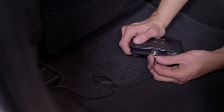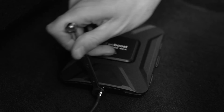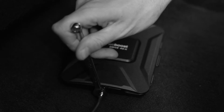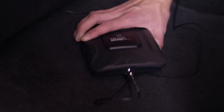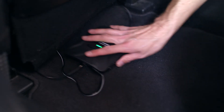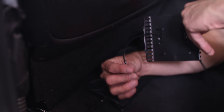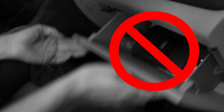Now install the booster. Connect the antenna cables to the proper connections on the booster. The cable connections should only be hand tightened — do not use tools, as using tools may over-tighten the connections and break them. With the cables connected, mount the booster in place. You can simply slide it under a seat or mount it securely in place. I'll use some zip ties to mount the booster under the seat. Wherever you decide to mount the booster, just make sure that it has adequate ventilation. Under the seat is fine; in the glove box with all of your other stuff is not.